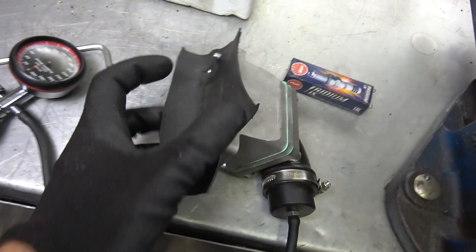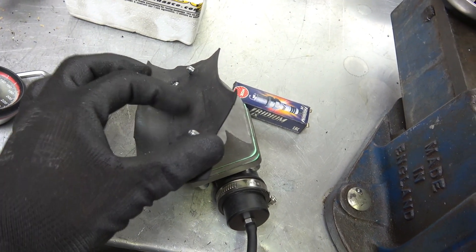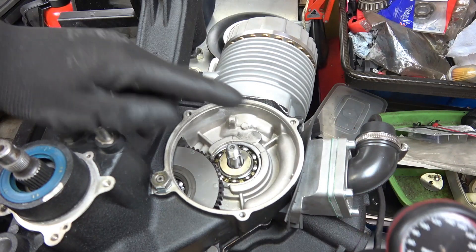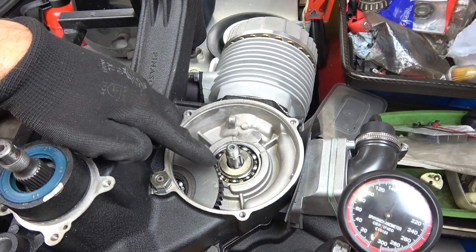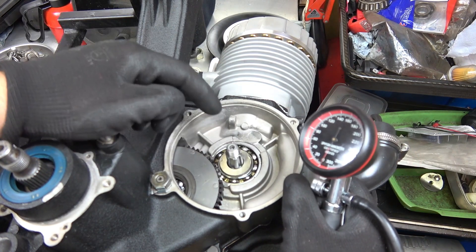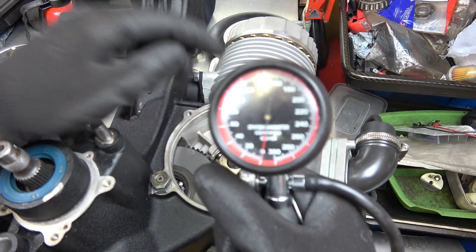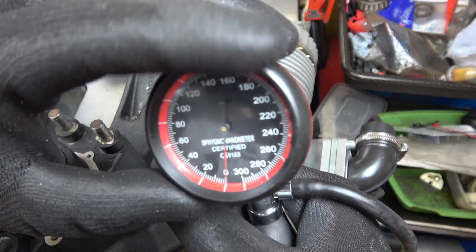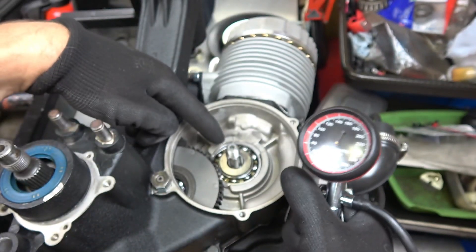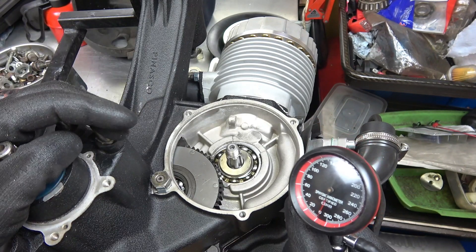The next step is to put a slice in the bottom of that rubber and bolt it down again, using it as a gasket — the pressure will then be able to get into the crankcase through the slot and we'll find out where it's leaking. I've sliced the rubber acting as a gasket and filled the main bearing with oil, so if I pump now and there are any bubbles through the oil, we know it's the main oil seal. I can pump as much as I like and it goes straight down — massive leak somewhere — but there are no bubbles up through that bearing, so the seal is fine on that side.